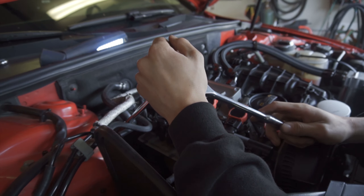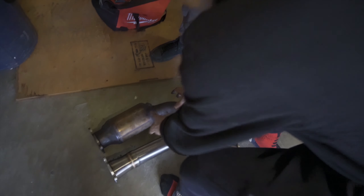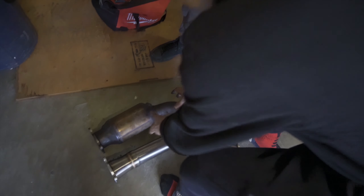There's no way that's coming out — the heat shield's coming off. There's no way it's coming down here. Once the cat's out, this pipe's in the way. Oh, it's cause the O2 sensor was on the thing — that's why. A little bit of an upgrade — we'll throw the upgrade on.